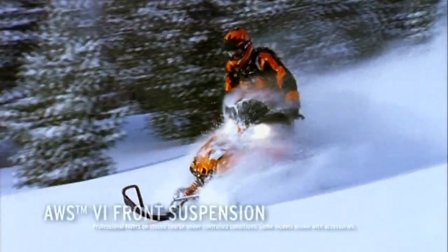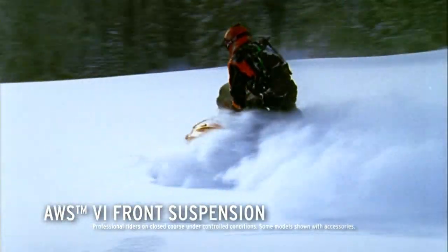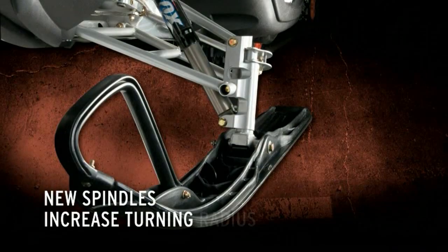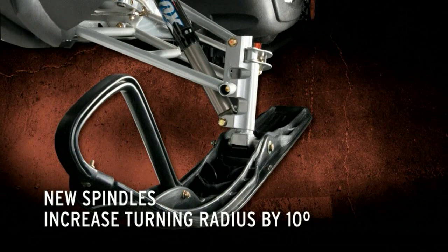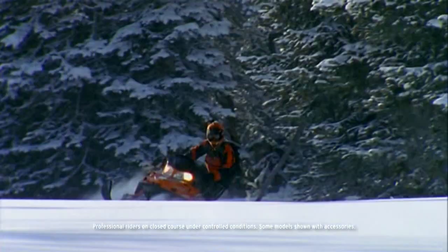Up front, the AWS6 front suspension handles the bumps with precision and ease. We added our racing spindles to reduce weight and tighten the turning radius by 10 degrees. With its narrow stance, this sled is perfect for carving and side hilling.